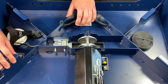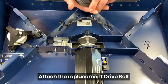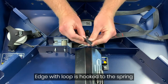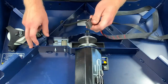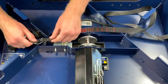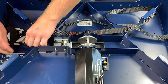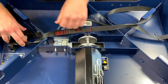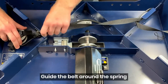I have the spare drive belt that each K-box comes with. One end of the drive belt will have a loop — that's how you know which side goes onto the hook. I'm going to grab the hook and hook on the new drive belt. I want to make sure not to just let it go and let it wind up, because that can cause a mess, so I'm going to guide this with my hands a bit.